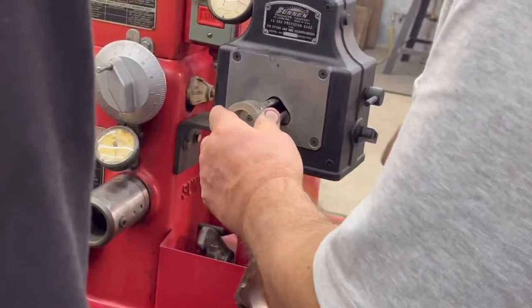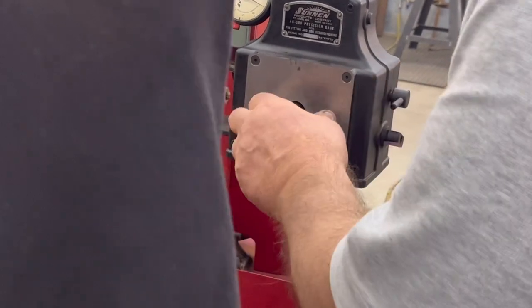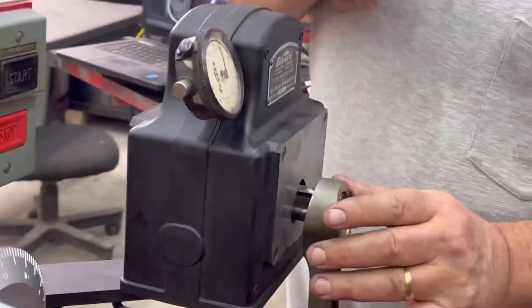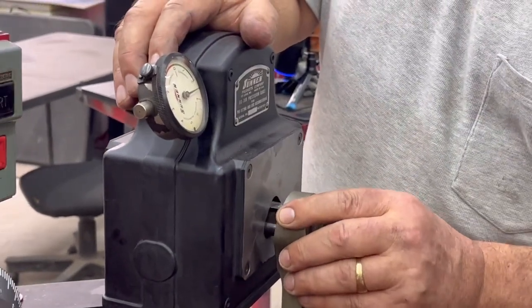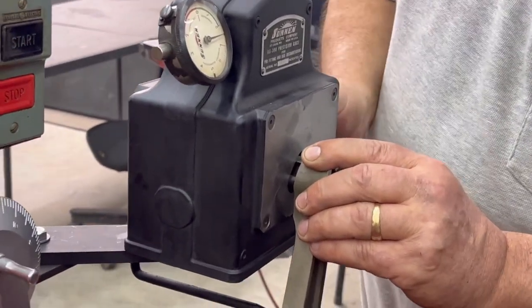So you're going to have to get the idea about wiggle and waggling to try to find your high side reading. So when you rotate a rod, one finger measures, the other one's static. So when you're trying to check roundness on the big end, you got to force it that way. Force it that way, gotcha. And up. Okay, and up. And up. See what I'm doing there? I still don't have engagement with that.